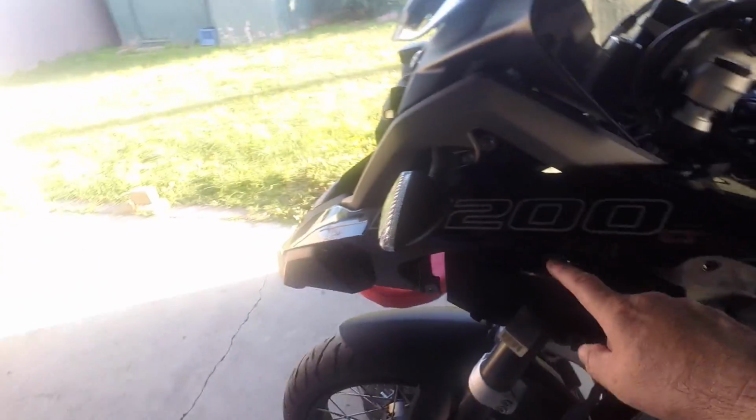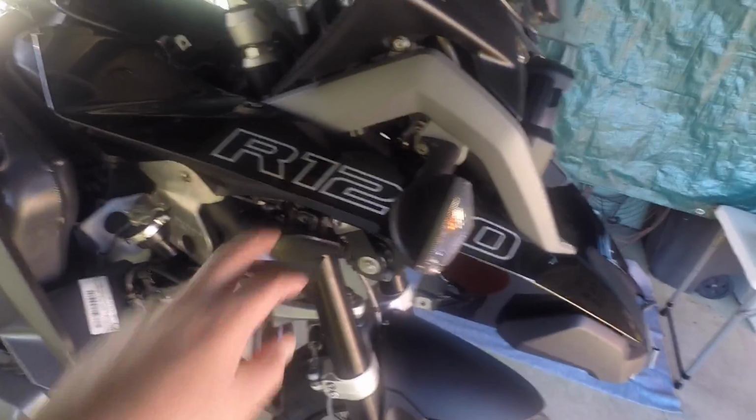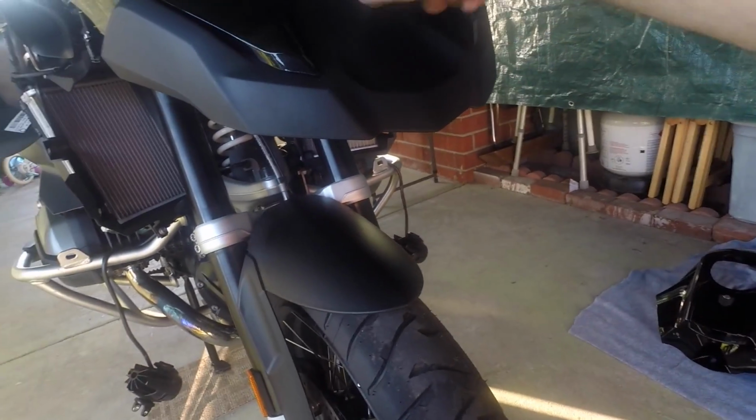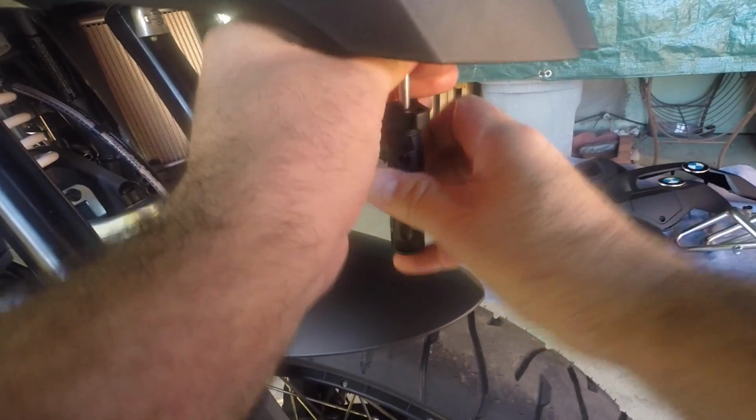So I'll be right back. All right, I'm gonna take off this front piece. So there's 2 bolts. One's here along with all the other ones, and another one right here. So that holds that in place along with those other bolts. Then there's 2 more underneath here. So we'll go ahead and get those off. And then there's a 3rd bolt that actually holds that piece together. But I'm not gonna take that off. We'll let that all come off as one unit.